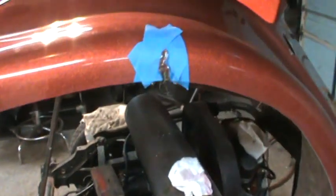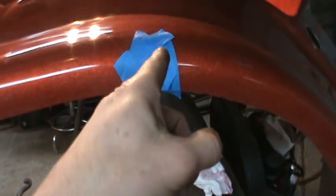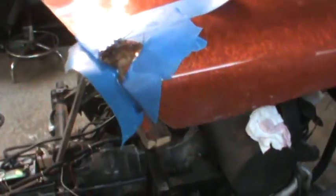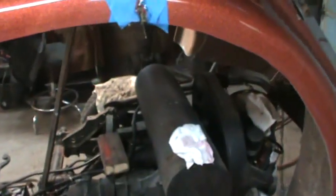First I went over it with some resin on the back side and just wet it, and taped off the front and wet the crack down there to feed into all the joints. And the same on this one right here. This one's just from the front side. I'll probably build that up a little bit, but I added some heat to it, so you can see it's dripping a little bit. But hopefully that will cure. And on the back side, you can see where it's roughly an inch past the crack all the way around. Should be a fairly decent bridge.